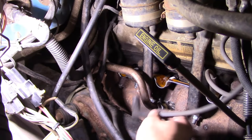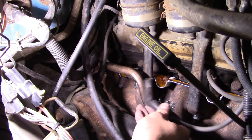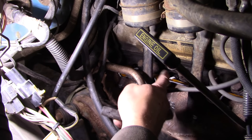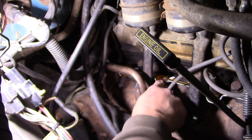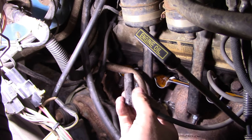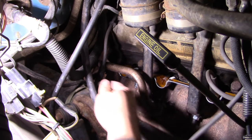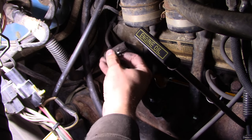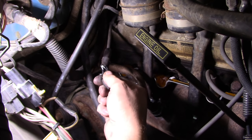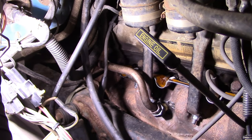The customer told me he replaced the spark plug wires and the engine ran better for a little while, then the misfire came back. It's pretty obvious what happened - because this exhaust manifold was loose, the exhaust gases were blowing right up onto the spark plug wells. The old heat shields weren't in very good shape, and it melted the boots. This one is all coming apart - there's the conductor right there. Cylinder number eight is completely destroyed. It needs another new set of spark plug wires, and we have new heat shields with the manifolds tight, so we shouldn't have that problem again.